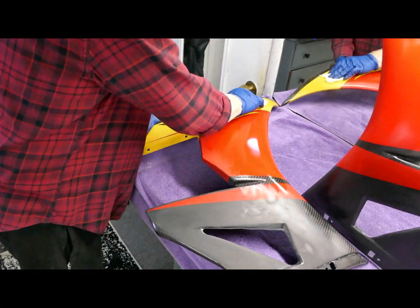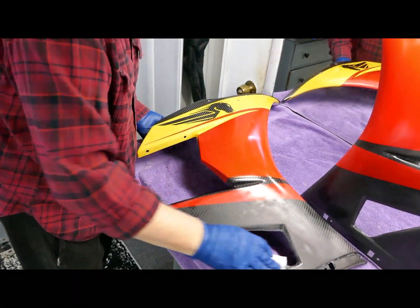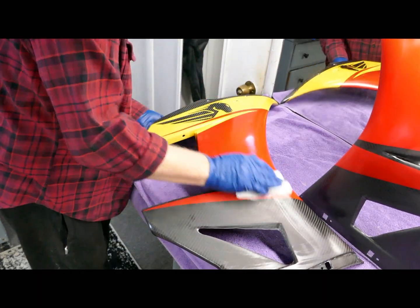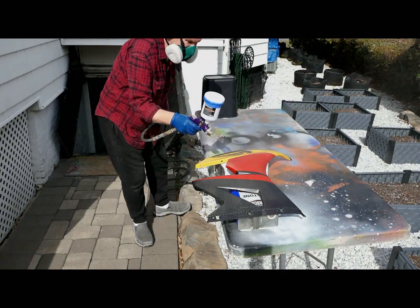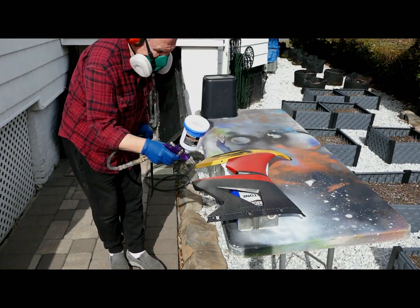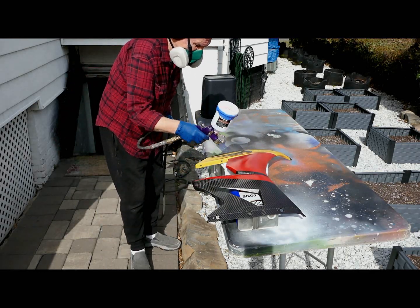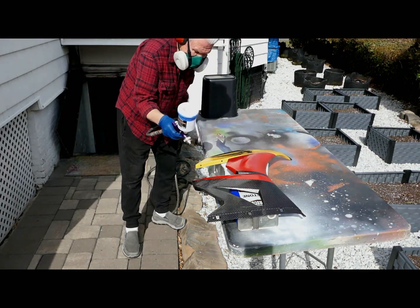I would normally have to waste half of the day sanding and then have half a day to shoot clear. Today I had a whole day to shoot clear. Now the day was getting sunnier and warmer, which is in my favor, and with the sun out now, I can candle how I'm putting the clear on a lot better, candling it every step of the way.